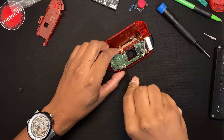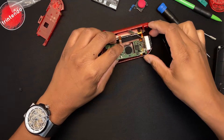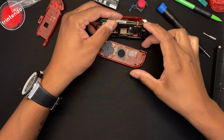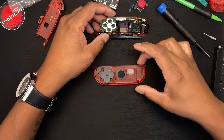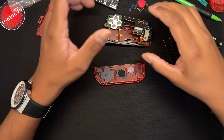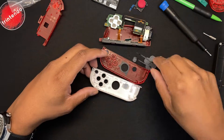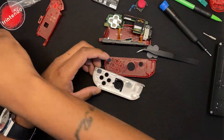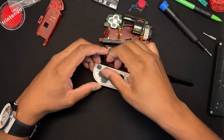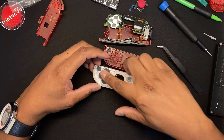To lift up the motherboard, stick a tweezer on the inside and lift up the metal shielding — it's quite different from the left Joy-Con, but nothing too alarming. The HD rumble is also adhered to the shell with adhesive, so it may not come out as easily. When you're doing your own shell swap, look out for that and be prepared to use a little bit of force to remove the HD rumble.